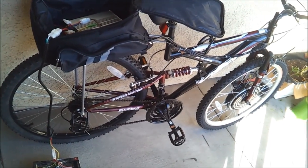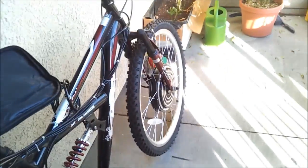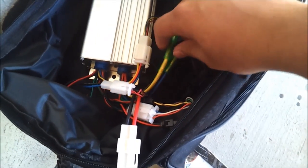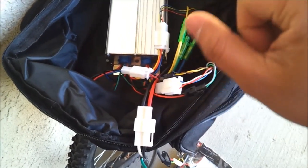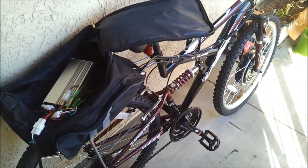If anybody can tell me if there's anything special I need to do to make this work, I'd really appreciate it. I think it could be two things — it's highly unlikely the motor itself is bad. I believe either the controller's MOSFETs are not working correctly, or the throttle encoder is not sending the variable signal when I press the throttle. That's likely why this e-bike is not working. Any input from engineers out there would be appreciated — thank you.